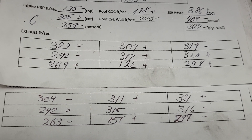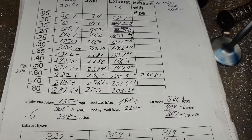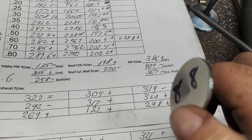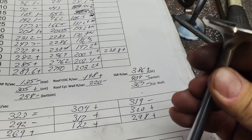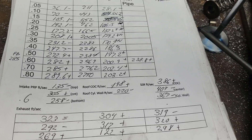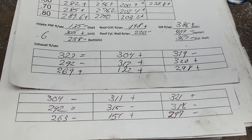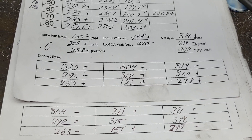As far as I'm concerned, quiet is good — noise in the flow I really don't like. I could fiddle with a radius on the leading edge of the valve; that might actually make a huge difference, but that's not part of this job. I could try a couple other valves, but flow bench time is flow bench time and I've already spent more time on these two ports than I'd like.